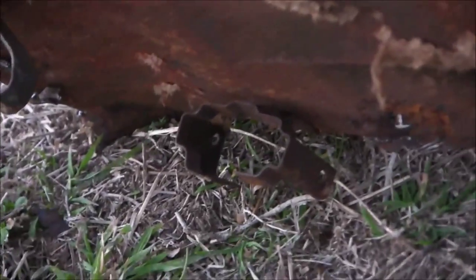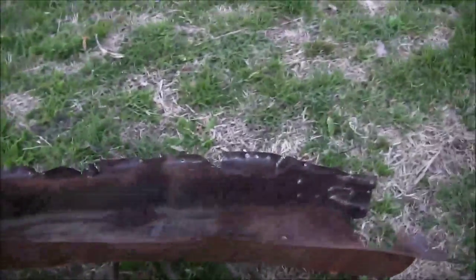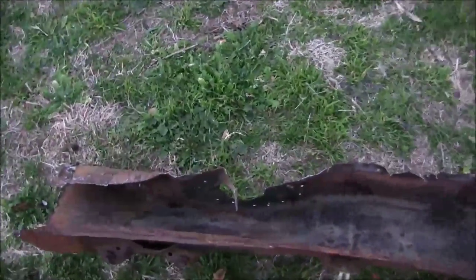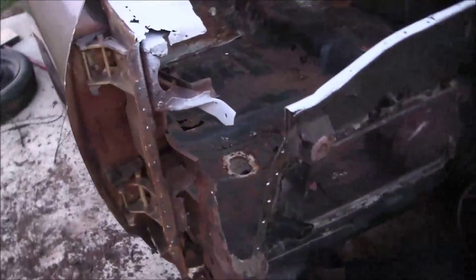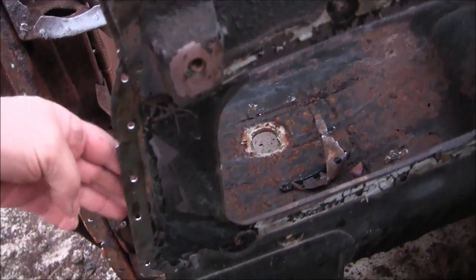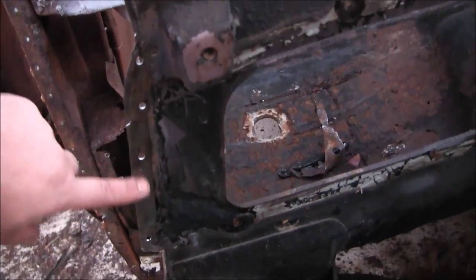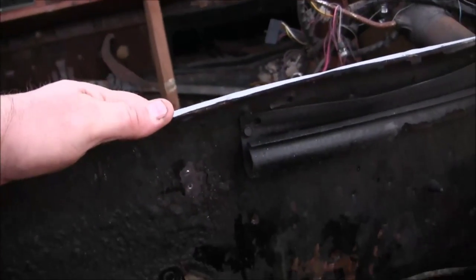That down there is some kind of horn relay bracket - I'll be hanging onto that too. I'm not going to throw anything away. Mark over at Second Gen had a whole bucket full of stuff he had saved from metal he'd cut off one of his cars, and I thought that was a great idea. All these spots that I drilled out - I'm just going to prep my new surface and then use my MIG to go in and tack them all back into the proper locations.